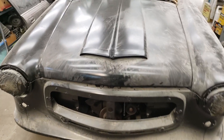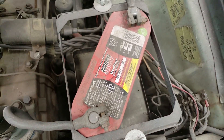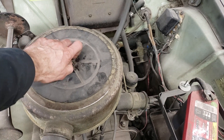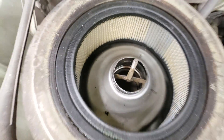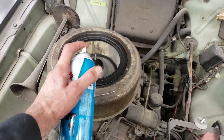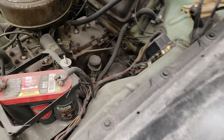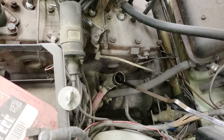I'll let you gaze at the nose — it's really pretty cool. I love this scoop. It's been a while. It's six-volt positive ground and I've got a gel cell in there; I charged it a few weeks ago. Let's see if we can get it to start. I'm going to squirt some fluid in it because it's going to take a while for the pump to draw fuel from the tank, so I'll take the air cleaner off. It does have a choke and the choke is closed. I think it's 196 CID — that's cubic inches — and it's a flathead. The fuel filter is dry so it's going to take some pumping. I had to rewire a lot of the cloth wiring that had been compromised over the years.